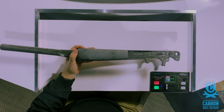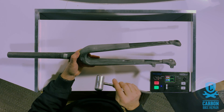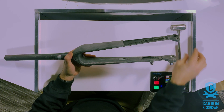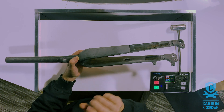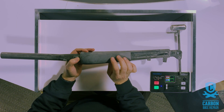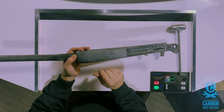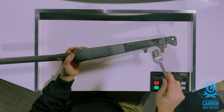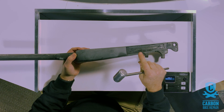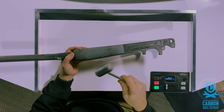Now when you're doing a tap test on a frame that is made up of various different thicknesses, you're always going to get different sounds. The point really is: what if there was a fracture in one of these areas? Well, we've shown you two examples where tap testing just does not show anything — this would be the same. You can see here — I'm going to tap across this edge and then onto this hollow, and there's going to be very little difference in sound.